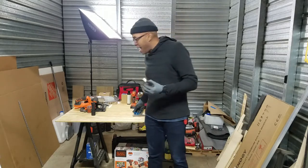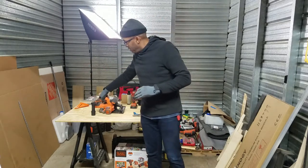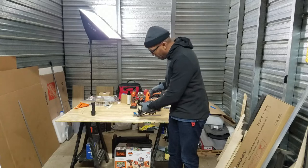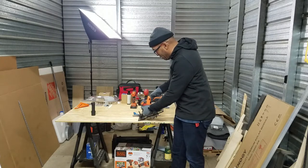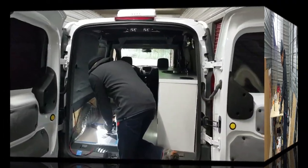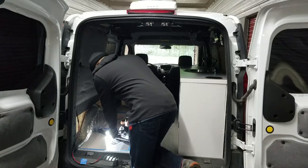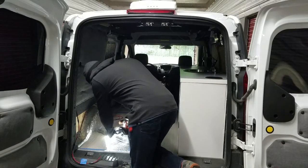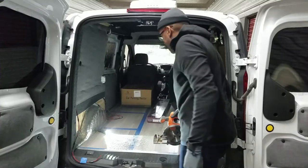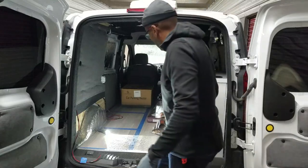So that is what I'm going to set the depth of my saw at and do the technique called the plunge cut. Simply taking your saw, kind of starting it out, setting it on your line, then starting the saw and cutting right in as the blade is moving. A little long, but that's a learning opportunity.